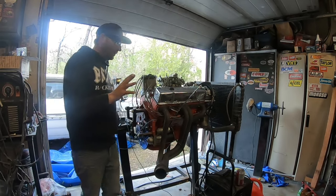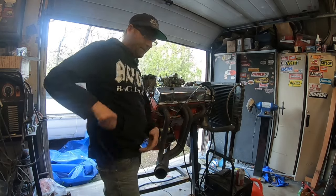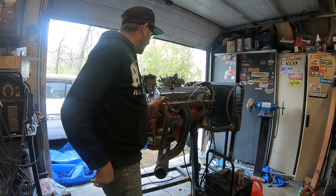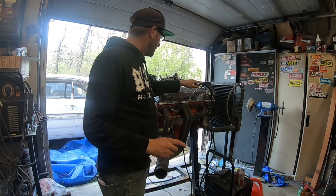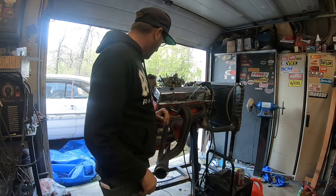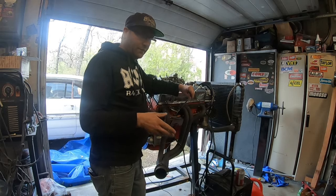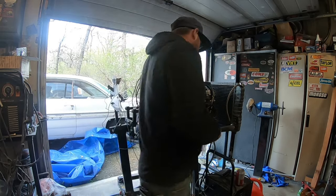Okay, guys, it's been about, clearly about 18, 19 minutes that I had it running in, according to my phone. So yeah, we're good. Like I said, I'll let it cool down, then I'm going to adjust the timing. I'll do that in a little bit afterwards, but I'll let it cool down and then check everything. And like I said, good practice later on, we'll obviously drain the oil, but I'm going to take the filter, cut it open, and just inspect, make sure there's no shavings.